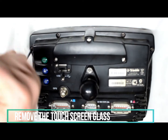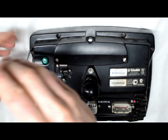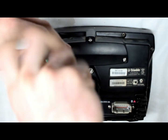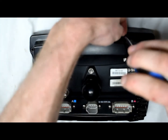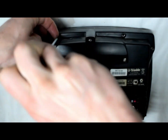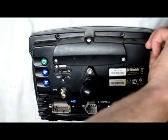The first thing is to remove the screws around the outside of the bezel. On the outside they're all the same length except the two side screws. I believe they are hex screws or Torx screws — I'm not too sure of the name — but they are about that long. You don't have to worry about the order because they're all the same length except for the two side ones.